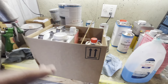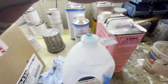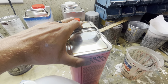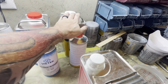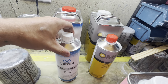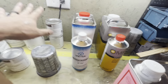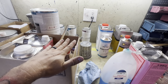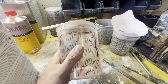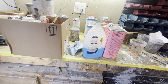Paint-wise, if you're doing base coat and clear coat, you're going to need your base coat. For me, my base coat needs to be reduced, so you'll need a reducer — this will change depending on what product you're working with, so ask your supplier. Then you're going to need a clear coat. We use the Omni 270 and also a lower-level Vitek clear. So: clear coat, base coat, reducer, strainers, mixing sticks, mixing cups, and a paint gun — that's pretty much going to get you rolling.